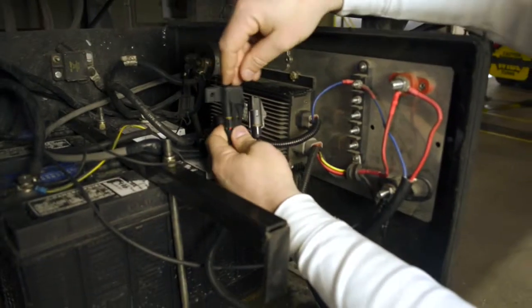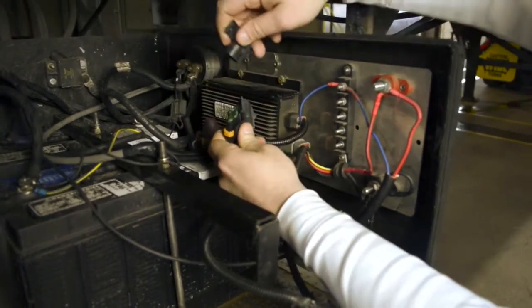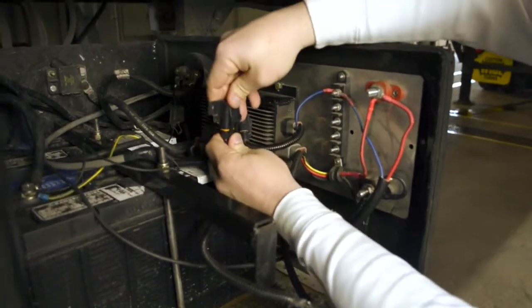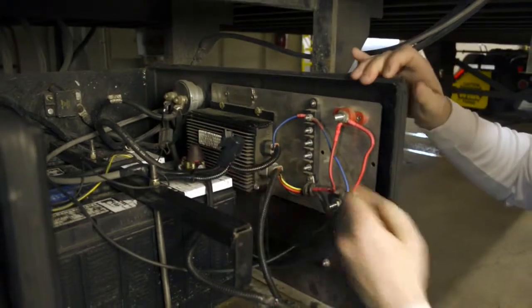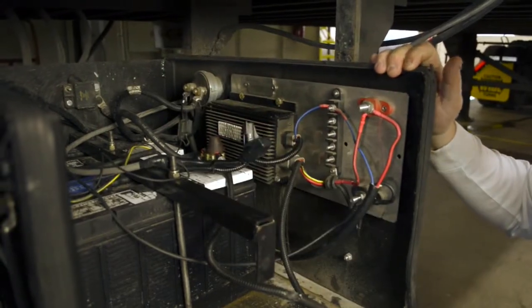The other fuse here is for the V-Check itself at the front of the trailer. All you're going to do is open them up and check the fuse, make sure it is good. If everything is lighting up on the front, you don't need to worry about it anyway. But if you ever get anything that's not lighting up properly, check your fuses in the liftgate battery box.